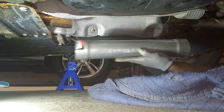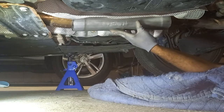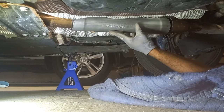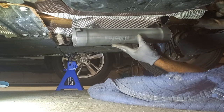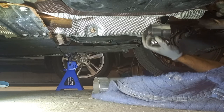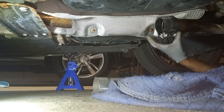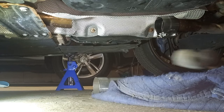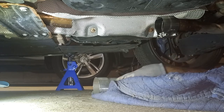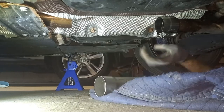Underneath the car, we see our pipe now cut to size. And it fits pretty well inside. Yes, it could have probably been a tighter cut, but it's okay because we do know that these clamps themselves have some length to them, and this will compensate for anything I misjudged. So I'm gonna clean up the edges, as it's also not so oily, with some brake cleaner as well as any metal flakes on this. I already sanded off the edges, and then I'll get to assembling this resonator.